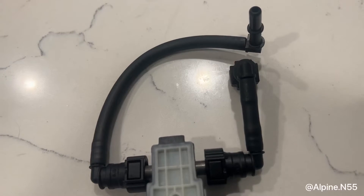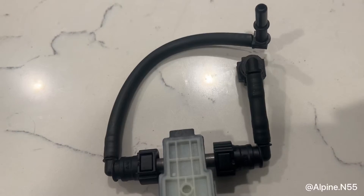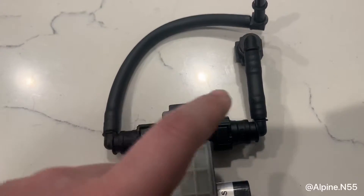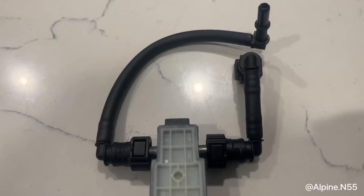I did use a heat gun to form that, but you need to make sure that you don't apply too much heat, and you also want to make sure you don't kink the line, because if you kink the line, I wouldn't suggest using it. Overall, these are both going to be the same adapter — 3/8 inch to 5/16th — and that's it. Let's go ahead and get to the install.